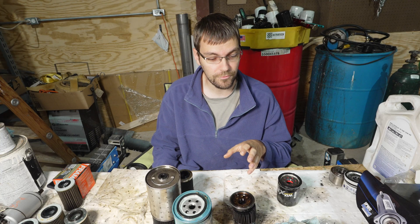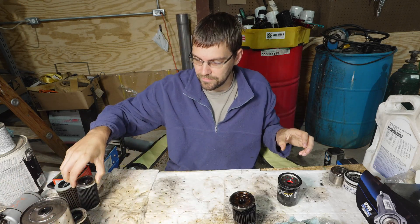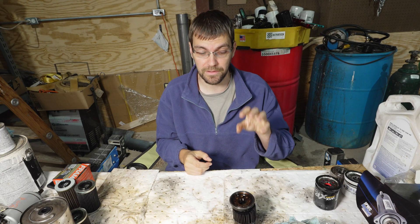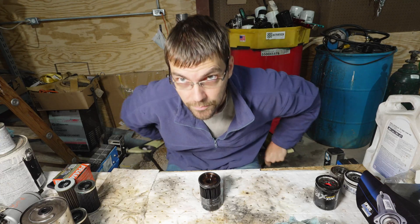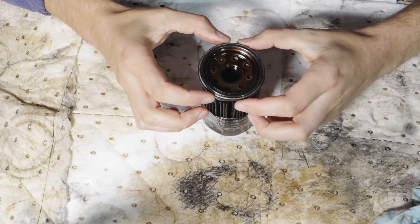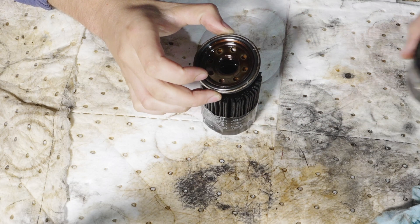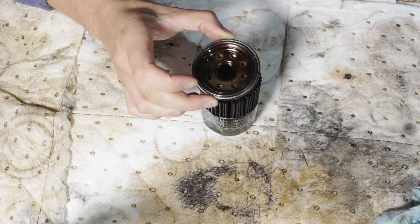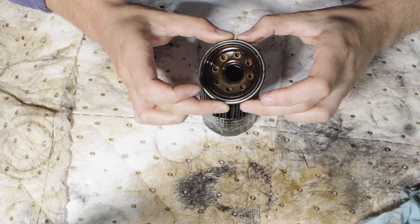This is probably pretty nasty. I've cut this apart — let's take a look at what the inside of this Yamaha filter looks like after 404 hours of run time. That's no break-in, nothing. This came from the dealership and didn't get its oil touched for 404 hours. Looking at this filter, notice that it is discolored. Comparatively, on a Wix filter that's been changed more recently, the metal is still silver, whereas on this one it is all discolored brown with some buildup that is clearly pretty nasty.